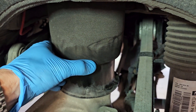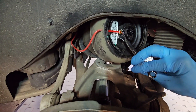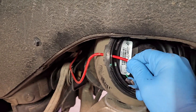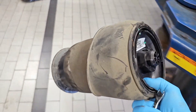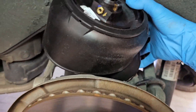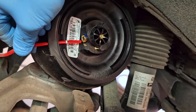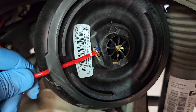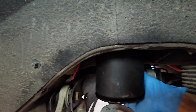You can see the damage on this one. I need to twist it, compress it, and disconnect the old air pressure line. I need to remove the old hardware — the new air bellow is equipped with new hardware. The old one goes in the trash and the new one will go in. I need to be careful to insert the pressure line; I have a mark there and I need to be sure it's fully inside. Now I will twist it to lock it in place.